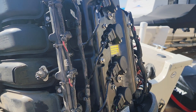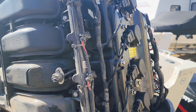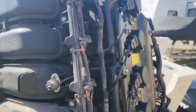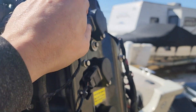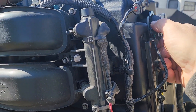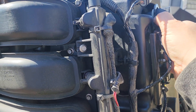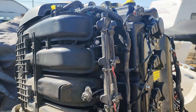When we request that a cylinder drop test be done, it's a little bit simpler with this engine. We're not taking out the spark plug leads — I'm disconnecting the coils. Let me switch hands so you guys can see better. I'm going to disconnect this coil and see if the engine stalls. If it doesn't stall, it's that cylinder. We give it a pull — it stalled. We know that cylinder is firing.